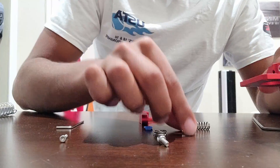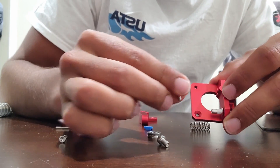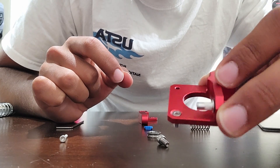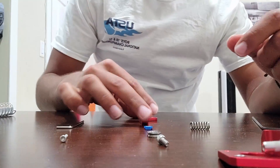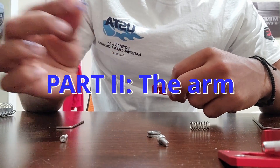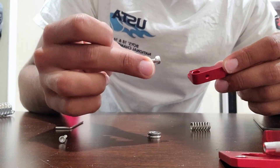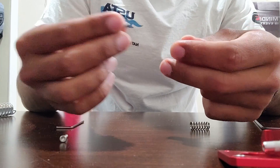To get to the left side, take the flat head small screw and place it in that corner hole. It should fit completely flat with none of it sticking out. Put that aside for a second. This kit comes with a lot of other things, for example a little blue clip, but you'll already have that on the Ender 3. The main thing we're going to use now is the fatter head screw and the V bearing — if you're not using a kit, you could find this on your old one.